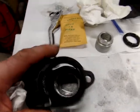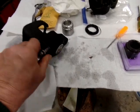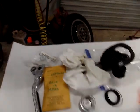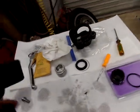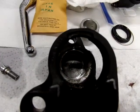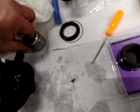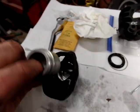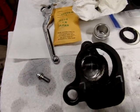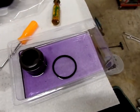The main thing is to clean it. I was watching a video with that guy who fixed my hog and he said to leave the bleeder — no. Clean this thing out, clean it all. I got new washers for the banjo bolt. I call it a banjo because the end of the hose looks like a banjo. But this was nasty in here, and I just cleaned it with DOT 3 brake fluid. I didn't want to introduce any strange chemicals into it. I cleaned it, put the old piston in and turned it a little bit. It's clean, it looks good, and it's got some oil in there now if you're wondering what that sheen is — lubricate everything you put in here.